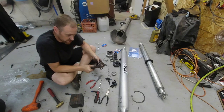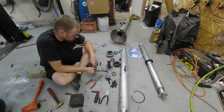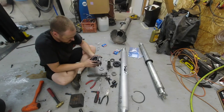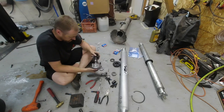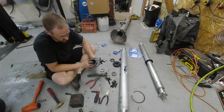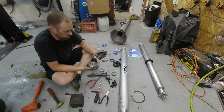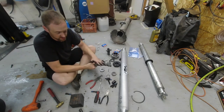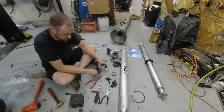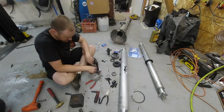You can take the shaft and bearings and throw them in the freezer — freezing them makes life a little bit easier for installation. But you have to consider: this bearing goes in first on this side, and then the bearing on the other side you push on after the fact. So freezing may not work as well for that end. This one, though, it is helpful to freeze it so the bearing just drops into place.